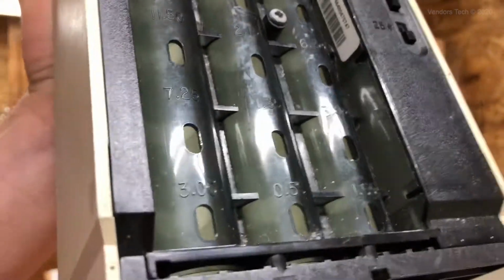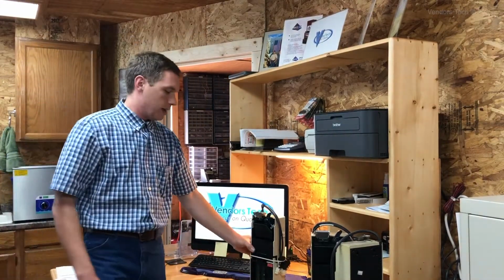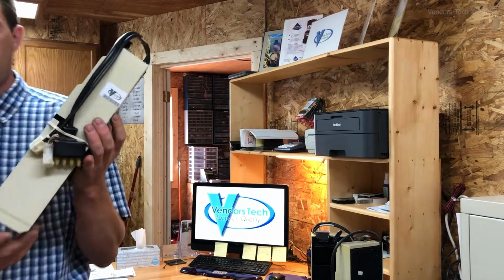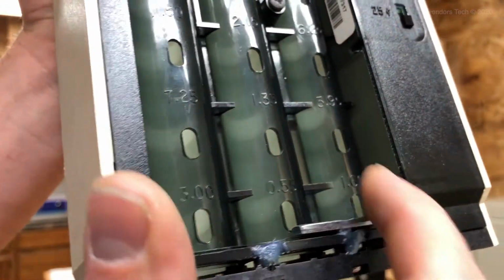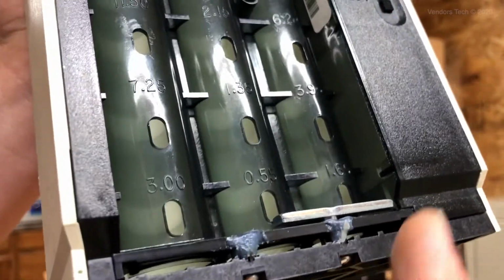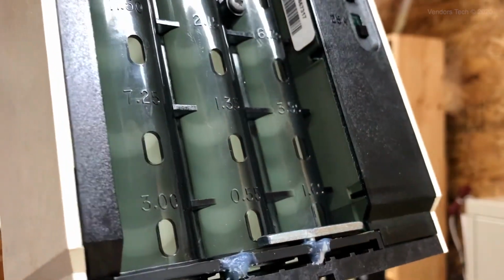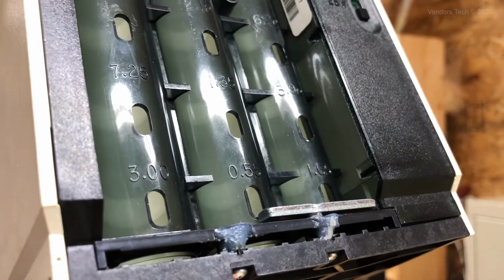We have to put a, I'll show you on this one, a dime support bracket to fix dime payout problems, and it requires a slightly thicker screw. So it's this metal bracket here, and a screw that goes up through that. When you take out a screw and put it back through that same hole, especially if it's a little larger, it's just going to crack it, and the screw is not going to hold on to the plastic. It's going to be ruined.